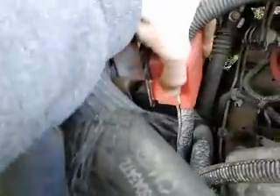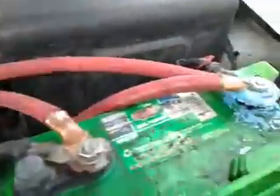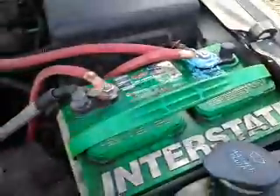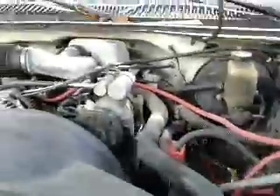I've got zero gauge wire running from the alternator — bypassed the old alternator hookup and went straight to the battery with it. Brought the power wire from this guy over to the battery also, so we bypassed that. Kind of a big three upgrade, but not really — mainly just runs zero gauge everything.